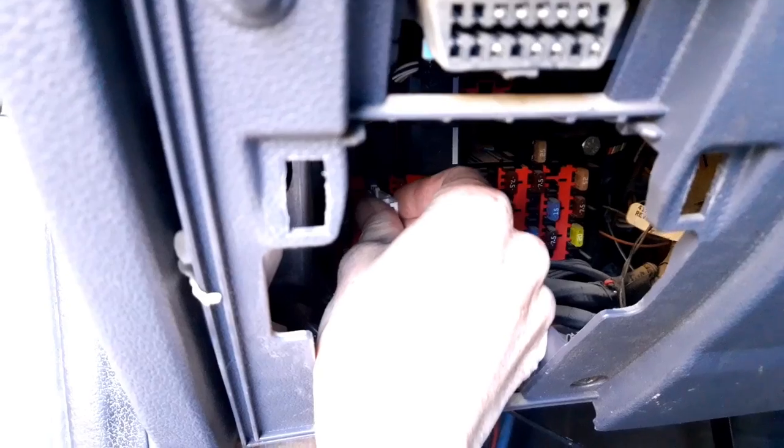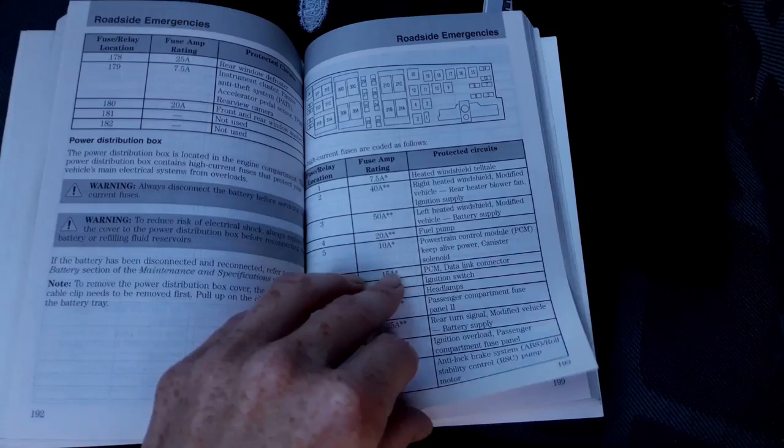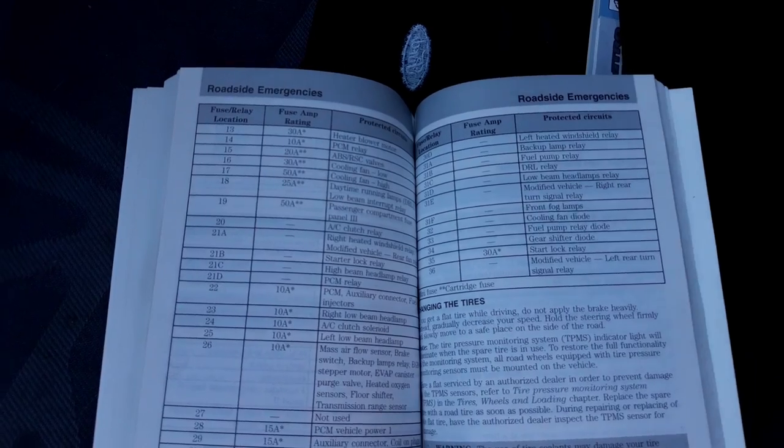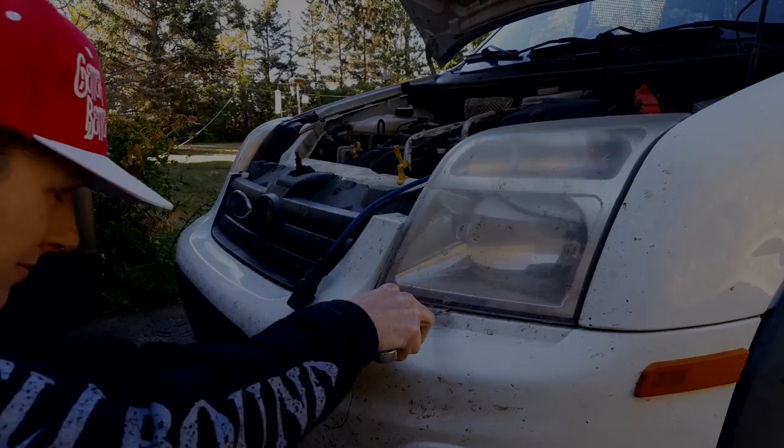The partial and occasional honk led me to believe that it wasn't the fuse, but I figured that'd be the easiest thing to check, so I did, and the fuse was good. Then upon going to check the relay, and thank you, Melissa, for confirming this, I'm not losing my mind. The relay on the 2010 Ford Transit Connect is not in the fuse box under the hood, like 99% of vehicles out there. Due to a mistake, there isn't one, or it's not serviceable. So my next step was going to be testing the horns themselves.